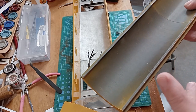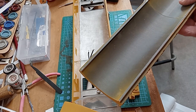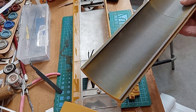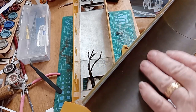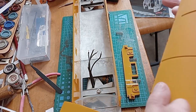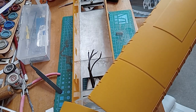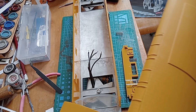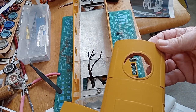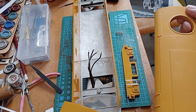To make it smooth — I've covered this in earlier videos — I've put car body filler on and rubbed it down. Once I've got it reasonably smooth, which you can see here, there's still a little bit more work to do. I'll probably give it another coat of filler primer and see how that comes up.